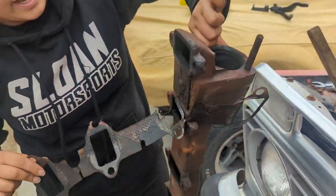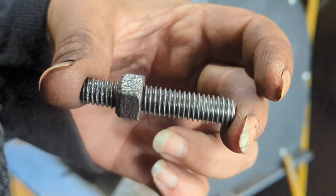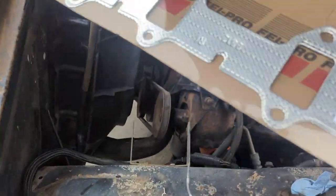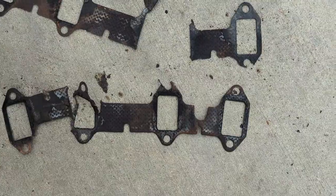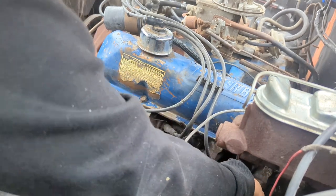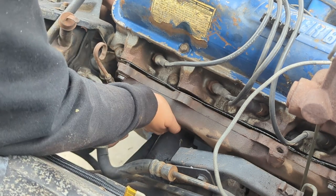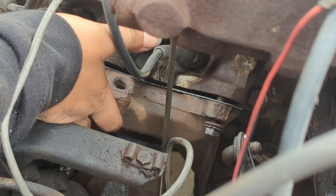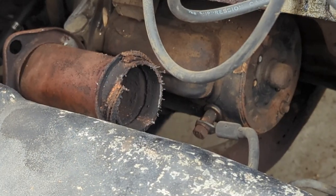Since these bolts are working, I'm going to be cleaning them up and reusing them. There's no reason to be spending money on bolts if I have them here - they're just a little rusty. I'm going to clean off just the threads. The bolts are all clean, time to slap the new gasket in. Putting on the exhaust manifold can sometimes be just as difficult as taking it off - you have to put the bolts on loosely, start with the top left, bottom right, then all the others fit in. You're going to have to wiggle it and jiggle it. On the passenger side, you can really see where our exhaust leak is coming from - that little donut is completely ripped. I'm going to be replacing that, then move on to this side manifold.